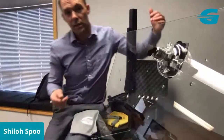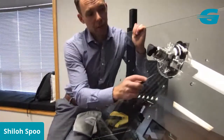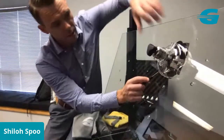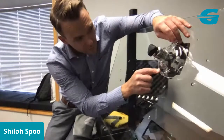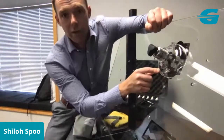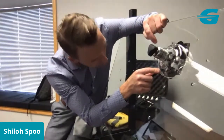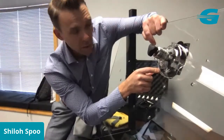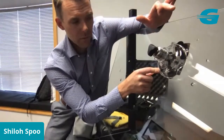So let me show you how you could use this. Now that we're injecting resin on the second one, we've got our probe here. Our probe can fit right through here. So you can either lift it up, or you can come in at a low angle like so, and you can probe those little legs. So without having to look under the flap of a UV blocker or look under a towel, I can see completely through this repair, or through the shell, see my repair that I'm working on while I'm working on it, while I'm flexing, and block 100% of the UV.